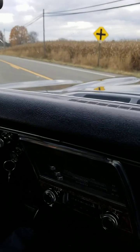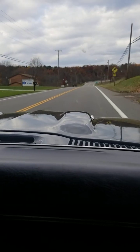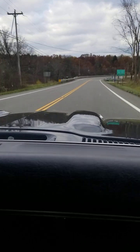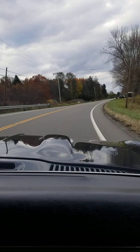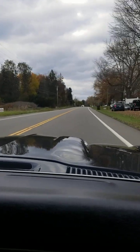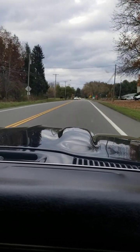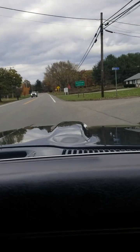You're going to want to take this thing out on a stretch of road that's fairly flat, because you don't want to let it idle any longer than you have to. We've got a little road over here that we take cars for test drives on — it's fairly flat. You'll see how we do this. It's real simple, nothing complicated. You just have to make sure you do it properly so that on a brand new engine the rings will seat right away and not start smoking or using oil.